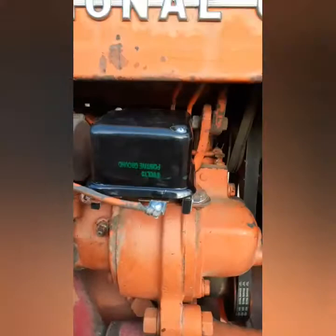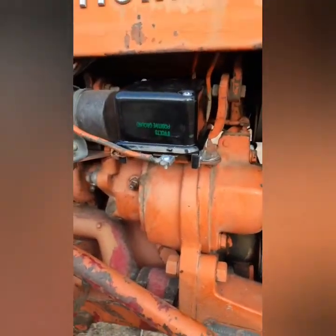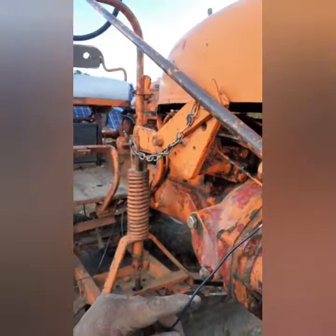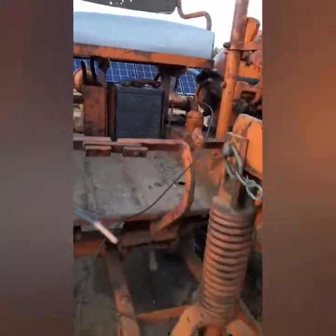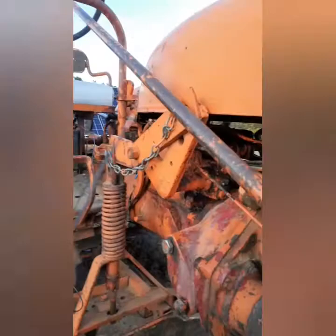All right, I'm back. Let's polarize that. You're actually polarizing the generator, not necessarily the voltage regulator, but every time you install a new piece of the electrical system — at least the regulator and the generator — you want to polarize it. What you do is take a wire, put it to the ground. Mine's a positive ground, so the red cable is ground, and you want to tap the armature ever so slightly, which is this cable right here. You can see it right there.